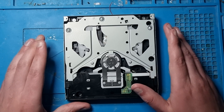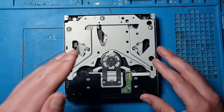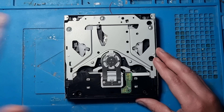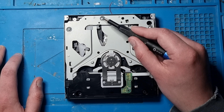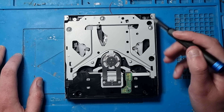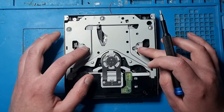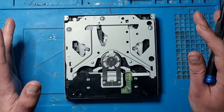When you've got a new drive - let's say this is a new drive and you're going to swap the board from your other drive and put it into this one - what's the one thing to not do? Do not take these screws off. These screws here, do not take them off. If you take them off, it basically resets these arms and then you've got problems - you basically face the same issues where the disc won't be accepted.